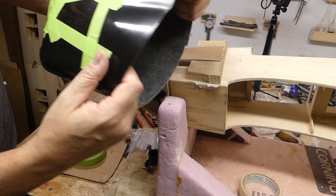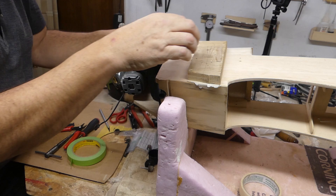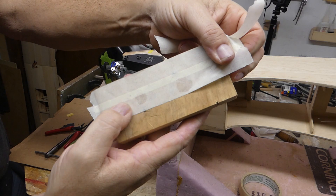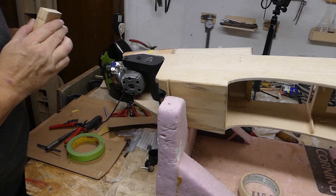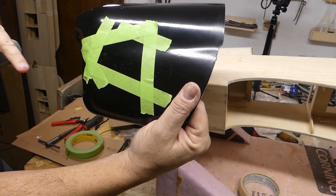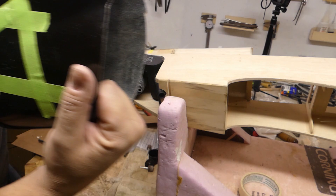So this piece here can come off, and we'll lift this whole piece up just by pulling up - there we go. You can see where the super glue was to hold it into place - Bob's your uncle, it's done. So let me go ahead and get this all ground out. I'll be using a Dremel, coming in with a cutoff wheel, cut a section out, and I think that's the 120 grit and we'll just come in and grind it out slowly. I'm going to tilt the camera down to show you how you grind your way through a cowling and not hack it up. Always have one of these things when you're grinding fiberglass - anything that keeps it out of your lungs is going to help you out in the long run.